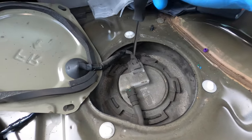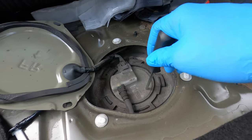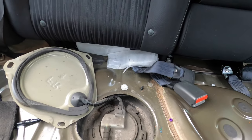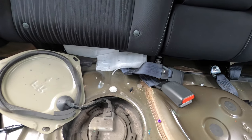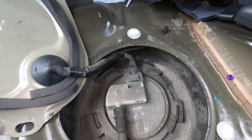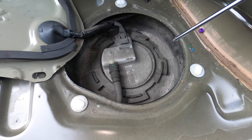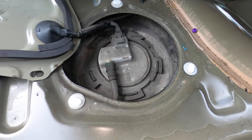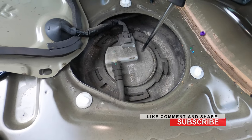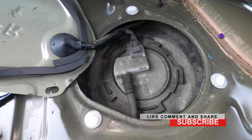This is their fuel pump right here. What I can do is turn the ignition on and see if you hear the pump. Most of the time in this car when you turn the ignition on, the car will turn the fuel pump on. So what you want to do is just turn the ignition on and see if that does anything — listen to see if you hear the pump go.